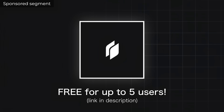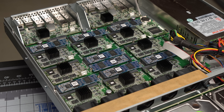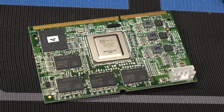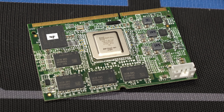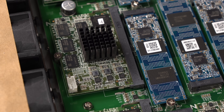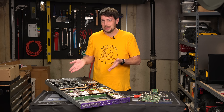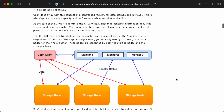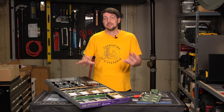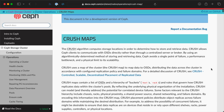The hardware specs on the Mars 400 seem modest on the surface. There are 8 computers packed into this thing, and just like a Raspberry Pi, there's not room for hundreds of cores or terabytes of RAM. Each module has a quad-core ARM A72 chip, 4GB of RAM, 16GB of eMMC, dual 2.5GB Ethernet, a SATA SSD in an M.2 slot, and another SATA bay for a hard drive up front. That's actually perfect for a little low-power Ceph node. Lump 8 together and you have enough for a 3-node cluster of Ceph monitors and 5 OSDs. The monitors store a redundant mapping for all data in the cluster, and the OSDs store all your data and make sure none of it can ever disappear or get corrupt — it's like RAID, but even more resilient.